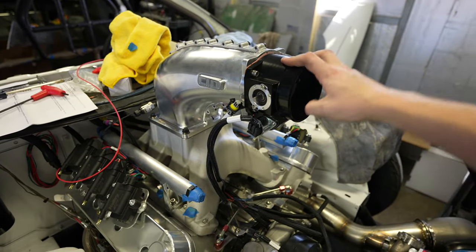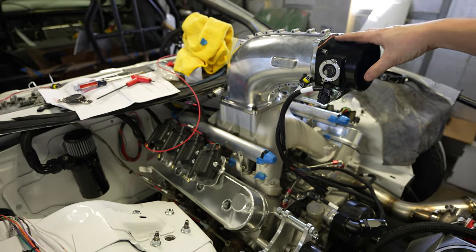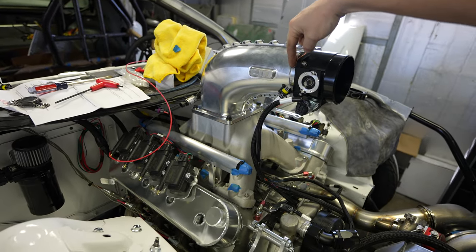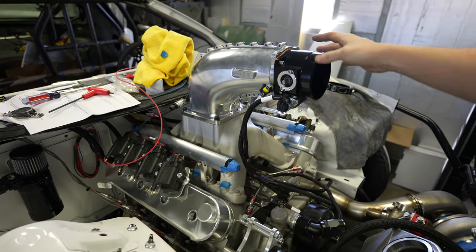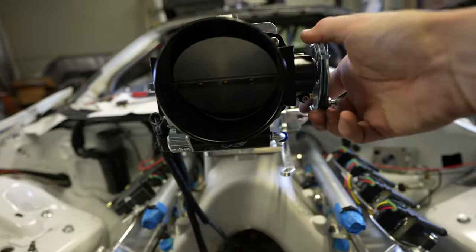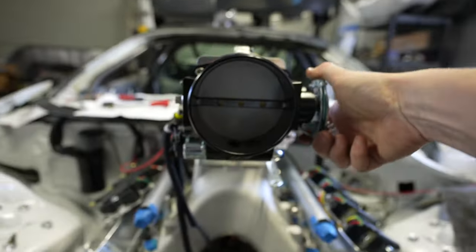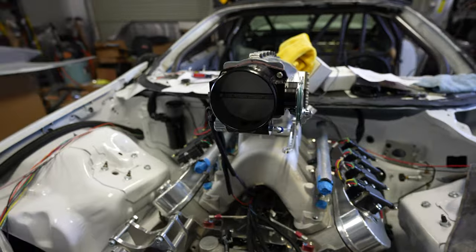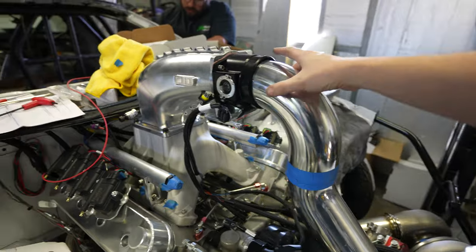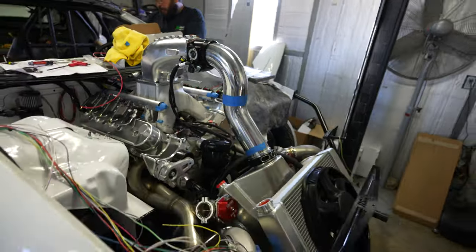One other thing: using the Holley billet throttle body, the CID is actually designed for like a Wilson 105, but I don't think that one had an IAC. I want to run an LS-style IAC, so what I did is I ended up drilling through here, tapping it, and mounting this throttle body on there. It works super good, everything looks great, and it clears real nice up top, so everything's good. Being flipped now, I can run it low — I've got this tacked and taped everything back to make sure nothing moved, and it's sitting just barely inside the lip.